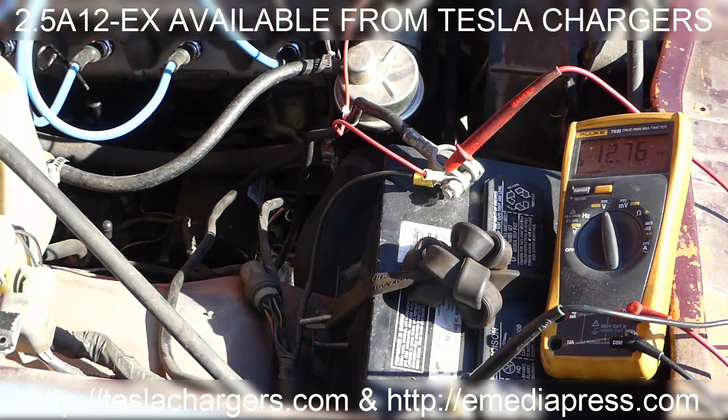This is actually two days later — first time I had a chance to get the battery back in the car. It's resting at 12.76. I think it was at 12.8 after the charger stopped, so it only dropped by 4 hundredths of a volt overnight. So at 12.76, I'm going to turn the key on and let's see if this thing starts right up. It's like we have a brand new battery — six and a half years old and completely rejuvenated.